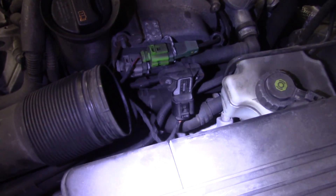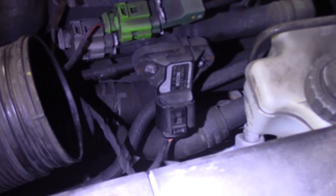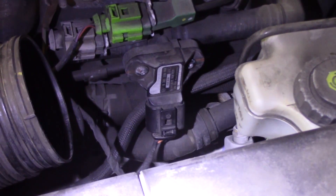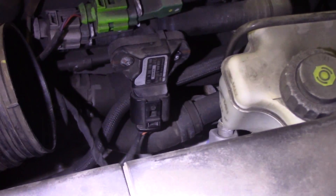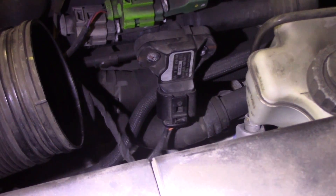What I want to do is back-probe and get some voltage readings. First things first, we'll see what is on this signal wire. The fault that we had was short to plus, so I am expecting high voltage on this signal wire.